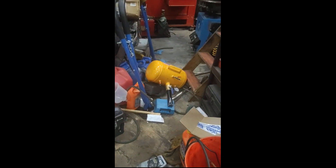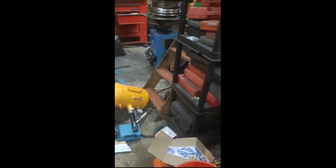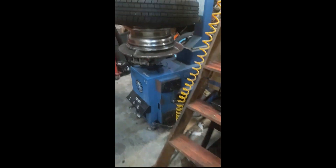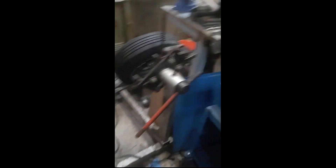What a day. I had a friend come help me with the tire and we still couldn't do it. Of course I still misplaced the air chuck - can't find it, so I'm going to go buy another one. I've got three gallon containers inside stretching the tire again. I even filled it with brake cleaner and lit it on fire and all it did was make me gasp for air. I think you have to use ether. This is crazy - I got the other three tires done, and the third one I left overnight with two gallons and first try it went on.